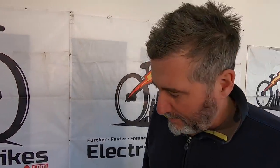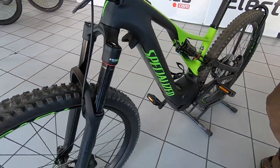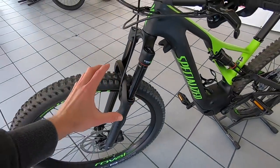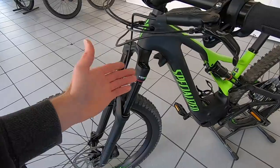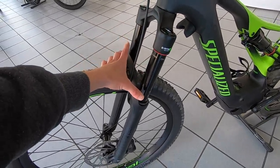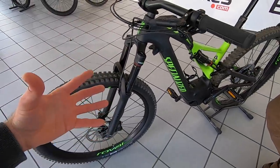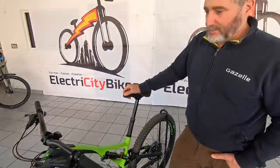What else did we learn today when we were talking to Chris? That it's now a little bit more linear suspension, so that you're getting less of a progressive feel with the air shocks. Yeah, and that's important. We were looking at this like DebonAir, we were looking up RockShox and stuff. There are no springs in here. I think they might call it an air spring, but we actually took all the air out just for fun to see, and the shock just sunk all the way down. So it's really the air pressure you put in, and that's almost like setting up a preload like you would on a spring suspension.